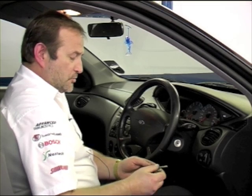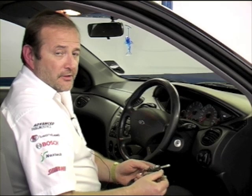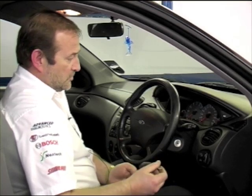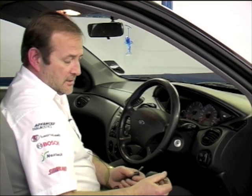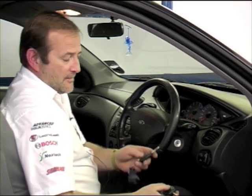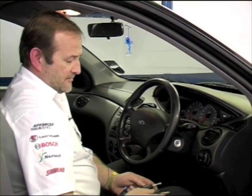The last procedure we need to carry out is to program the remotes. On this particular car — the Ford Focus — the remotes are a manual process. The process is to switch the ignition on and off quickly four times, and we will get a bleep from the car to tell us that it is in programming procedure. I quickly follow that by pressing the lock button on each remote, which will again give a bleep to say that the remote has been stored into the memory. Carrying out this process will delete all existing remotes, so it is important that you program all remotes in at the same time.